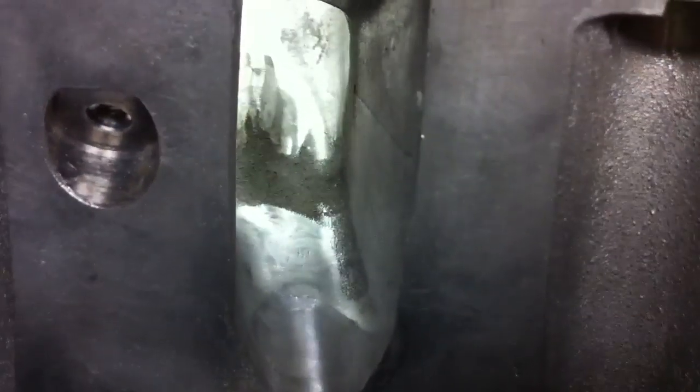80 grit. There's one on the tool. I've already started on the intake. I'm going through here with the short mandrel on the Tootsie Roll, and I've gone in as far as it reaches. As you can see, I haven't touched the pointer here.